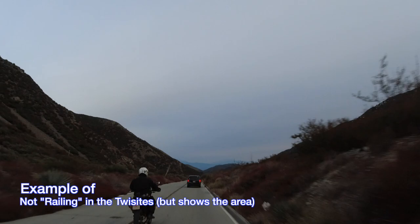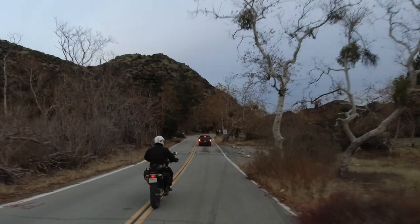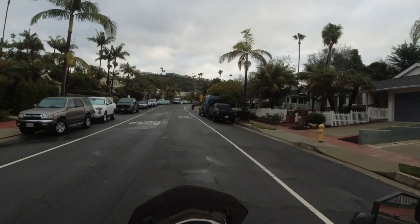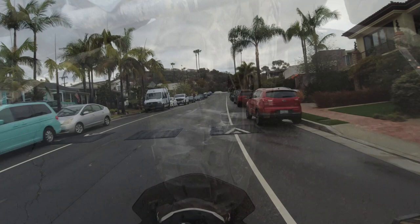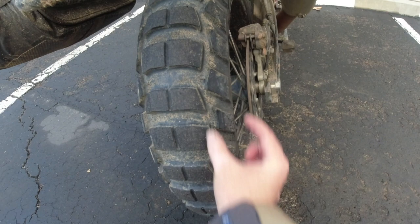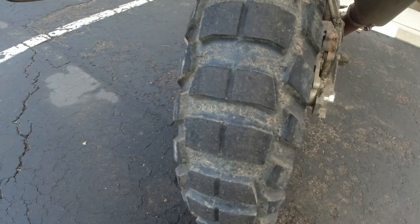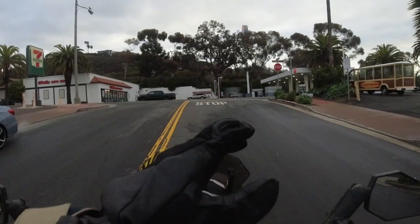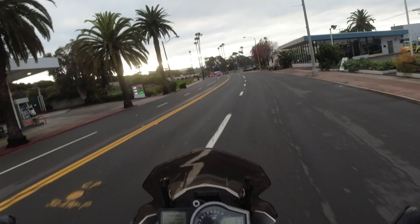What I found is that they corner really well — they turn into corners super quick, super easy. It's awesome. The problem is in that transition from being upright to being all the way over into that corner, you actually lose tread patch to the ground. Leaned over into corners, you can't really use this side — it's almost inaccessible to the ground. When leaned over I've got this rubber strip right here hitting the ground, so not a ton of rubber is making contact. The sidewalls are not soft at all, so that tire isn't changing its profile and you're getting less and less rubber contact as you go over.